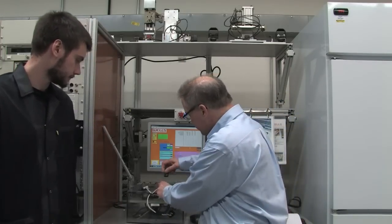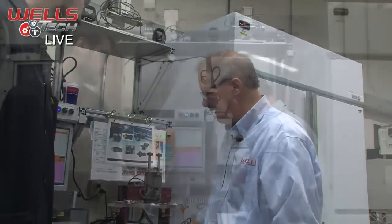This is the one-bar sensor, normally used on naturally aspirated engines. To get more horsepower, turbochargers are installed — those read two and three bar. When I refer to bar, I'm referring to the pressure reading. Typically, one bar is at ambient pressure; two bar would be twice that amount, and three bar would be three times that amount.